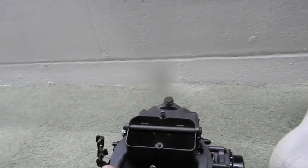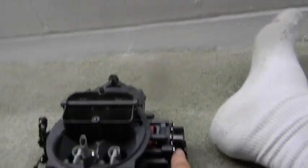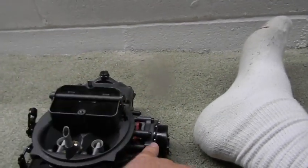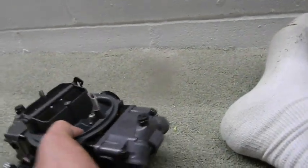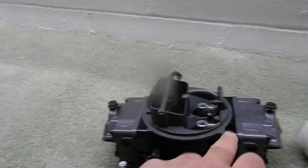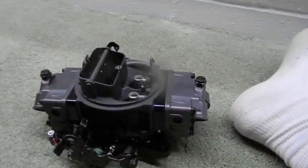Look at some of the carbs. Let me put you under the light. So this is the 600 Ultra Double Pump, they call it. They had an optional choke — the difference between with and without the choke was fifteen dollars, so I said to Junior, I never had luck in the old days with Holley chokes, but I might as well get it. If it works we're fine, if not I'll just take it off. The 'Ultra' means it's made of cast aluminum, anodized — that's the gray and black finish.